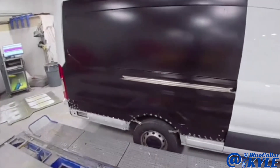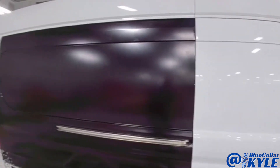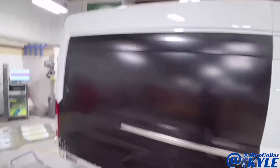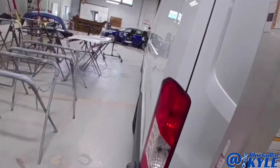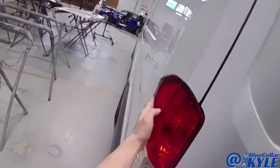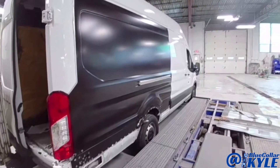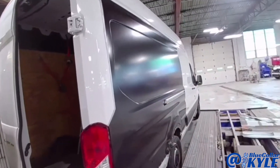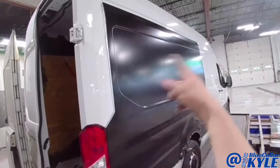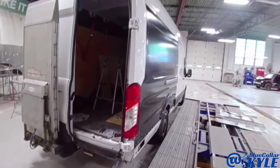I have this one all fit together. I have my door gap lining up nice and even, all my gaps around as well as the taillight. It doesn't fit perfect — it's a little sloppy — but this side is the same way, actually worse. Some of these big panel vans are a little sloppy. So I'm going to go ahead and pull this one back apart. I have to lift that panel back off to get some sealer back behind there, then I'll lay out the sealer and get it put back up and welded on.